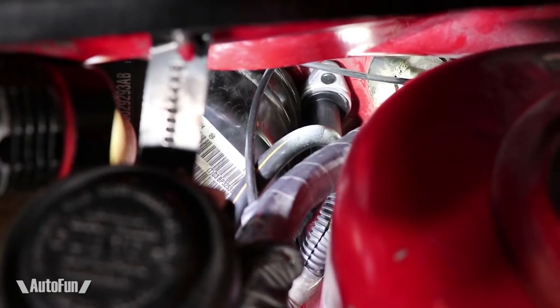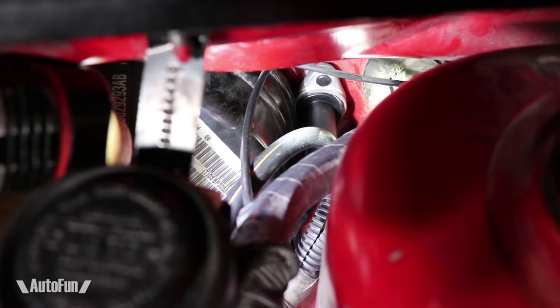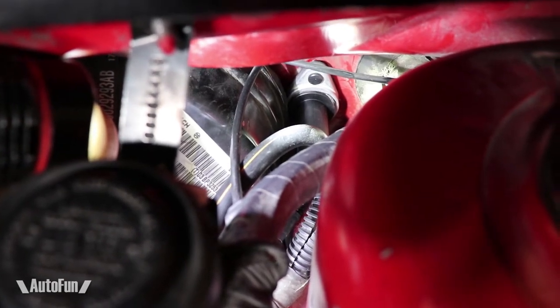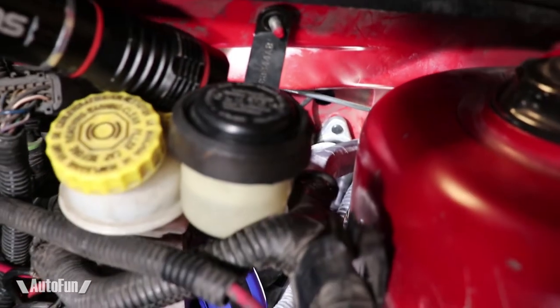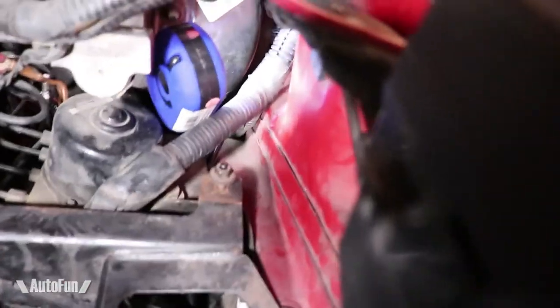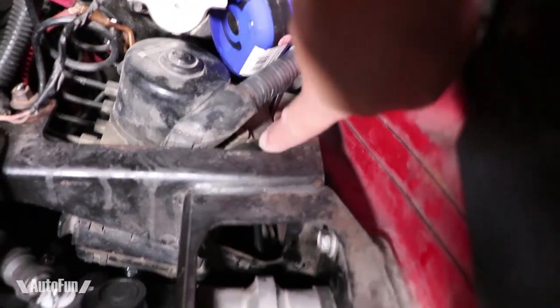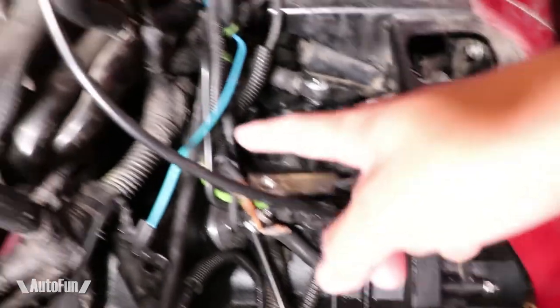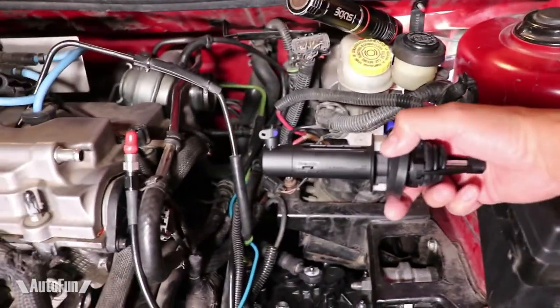Getting the new master cylinder back in can be quite challenging. However, with some patience, it is just a matter of wiggling it until eventually it pops into place. Here's the new reservoir — it's already filled with fluid and free of air just like the rest of the components. The new line goes underneath the battery tray following the original location of the old line, and right now it's going up so I can attach the slave cylinder. Watch the video on how I bleed the air out of the system — I've placed the link in the description below.